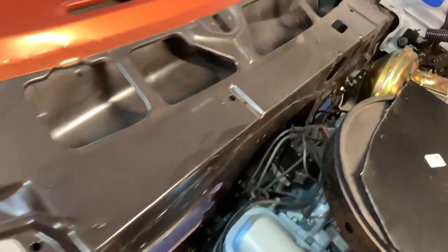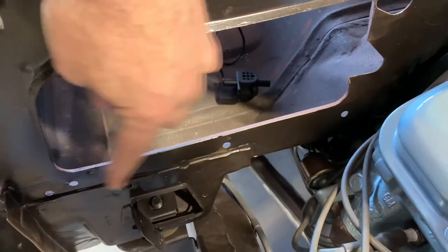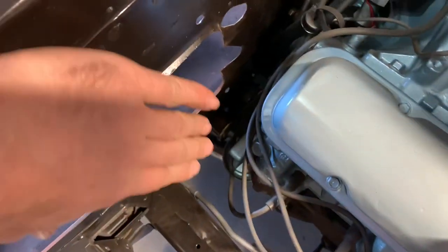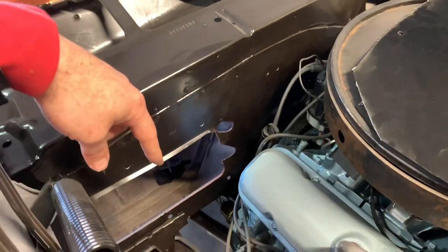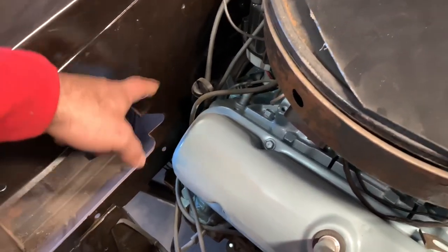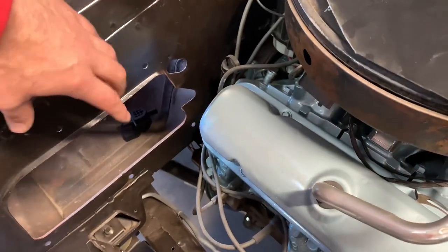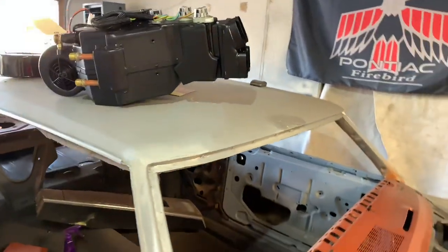Here on the firewall — that's the vintage air block-off plate. These holes line up in correlation with those holes there. But see this flange right here? They want you to buzz that off flat, which is fine if you're going to do this setup, but I'm not going to have to mess with this whatsoever. So in case of some crazy reason you wanted to restore this car 100% back to normal, no modifications to the firewall. The heater core hoses are going to come out just like the factory case — one's five-eighths, the other's a three-quarter inch barb coming out. We can loop it up to the intake and the water pump and use the factory heater core hoses.